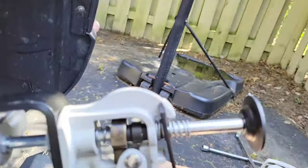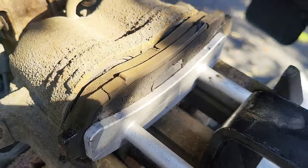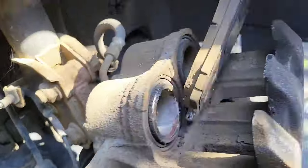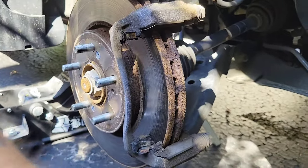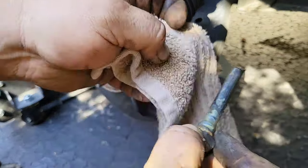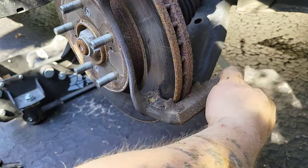It's bigger than a C-clamp. If this was smaller, I think it would be dynamite. I've got another one too — somebody sent it. That one is the double for the double piston, and the other is just for one. We've got to get rid of this hardware too. Let's check these out real quick — you know what to do with these. Pop them both out, clean them off with your towel, get some brake grease, put new grease on it, and then slide it back in there, just like so.